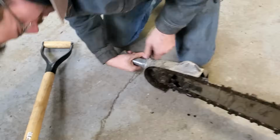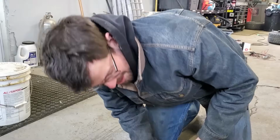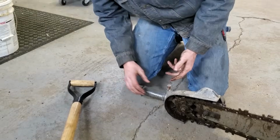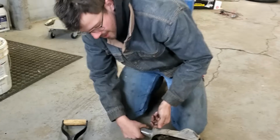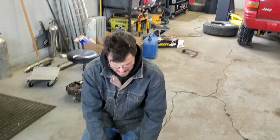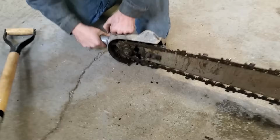And he found it. Tell him what you found. It's actually pretty crazy and genius. So down here at the second man handle, there's this little bolt-looking thing. Well, it turns out it's a pull pin. You pull the pin, you twist the handle, and it turns a screw inside like a normal tensioner on a chainsaw, and it pulls this end of the handle with the sprocket forward and back. So that's super easy. Don't even have to loosen any bolts.